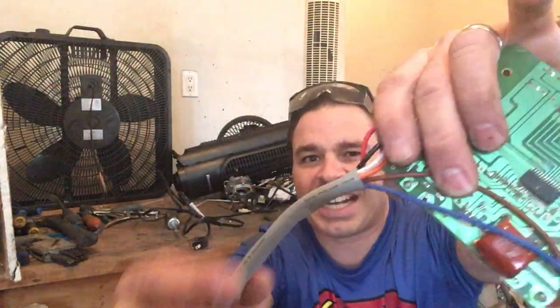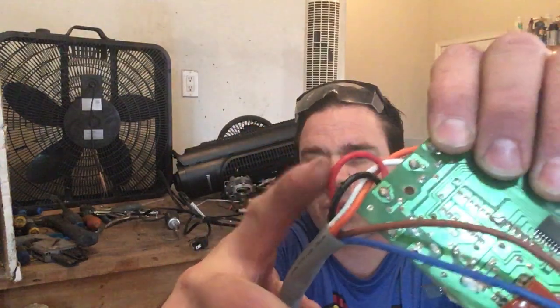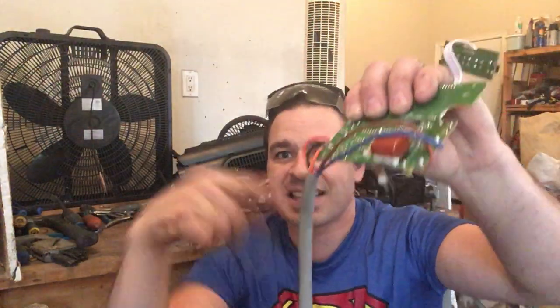So you notice that it has individual coated strands right here, but it has an outer coating as well. Because this has an outer coating, it gives me 2 layers of plastic, so there is less copper recovery. This would be an example of 40% appliance wire, and this right now is actually going for $1.25 a pound. So still an excellent price, but you definitely want to make sure you separate it from your 60% to get that higher value for the inner cord.